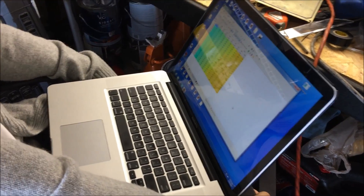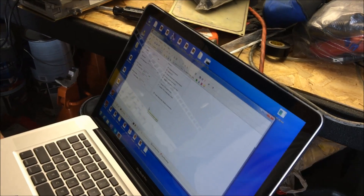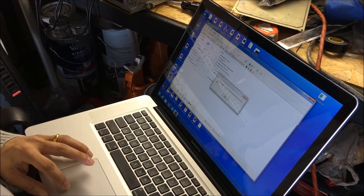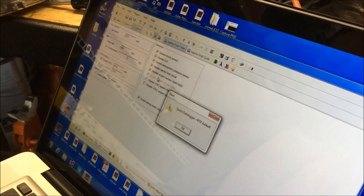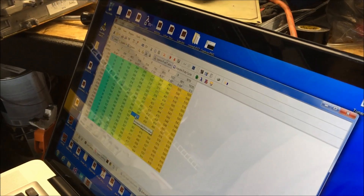Here's a standard map for the D16 Y8. I go through and do the basics as a normal routine — remove error checks, add in the quick data logger and RPT so the capability is there if I need to do some data logging off this binary map file. This map is already tuned for a D16 Y8.